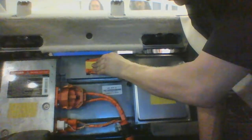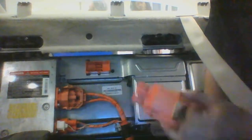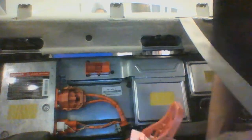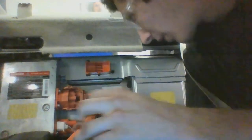Now that we are all uncharged and nothing is powered up, go ahead and lift up like so and pull out the high voltage relay fuse. You want to set this either on top of the vehicle or somewhere you won't lose it, so everybody knows it is disconnected and you won't hurt yourself. Now you are ready to do any kind of service necessary on this vehicle. This was John with J Tech — hope you learned something new today, see you next time.